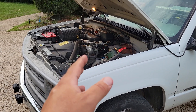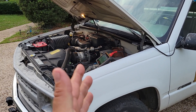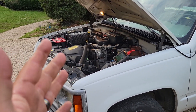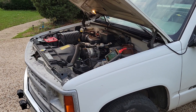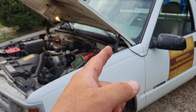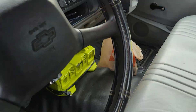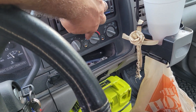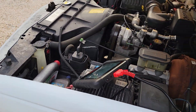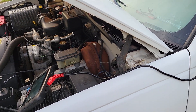What it does is — let's say you're in traffic, it's 100 degrees outside, and you've got it on normal AC instead of recirculate, and your high side pressure gets way past 320 because it's so hot outside. If you trip that switch, it'll actually turn your AC on max recirculate for you automatically. You don't even push the button — the light won't come on, but it'll switch to recirculate to try to lower the system load.